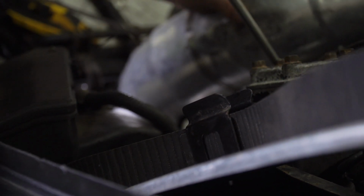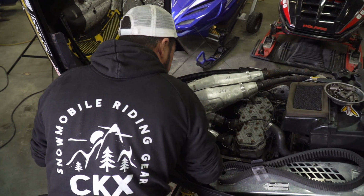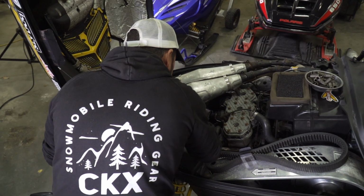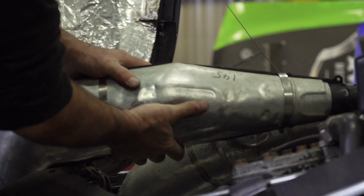Now, Wiseco has pistons with up to a 5mm oversize, and that would bring this 809 up to 889 cc's, but that's just crazy talk. And there would have to be significant work done to the jugs to accept this kind of kit. For the Scuz-Z, I'm not looking for that kind of performance, not yet anyways.